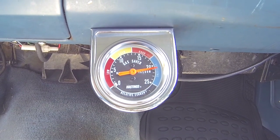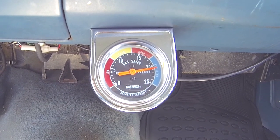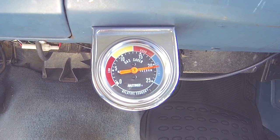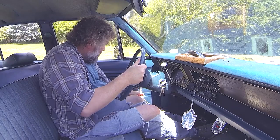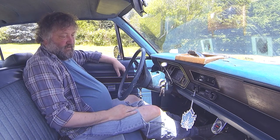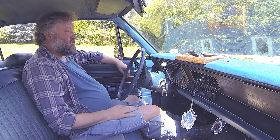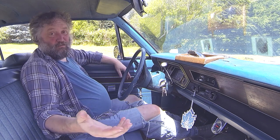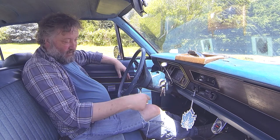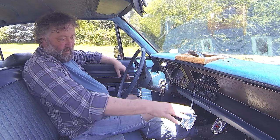That's something totally not required anymore. There's probably a vacuum sensor or something that would put the engine light on if something were off there, but this is how I used to do it in the analog days. I really haven't had to crank this car that much — I didn't have to crank it that much when it had been sitting for two and a half years. Maybe the linkage is getting weak in there or something. I don't think it was actually setting the choke on the first two attempts there, because notice on the third attempt it went right, as it should do.